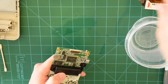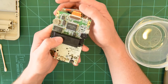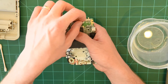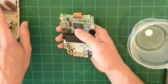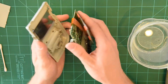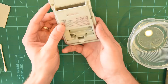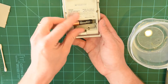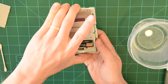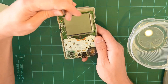I'm going to put the screen back in. Right here I have a screen that we disassembled from the last video, and all you've got to do to reassemble it is put this ribbon cable back in. Push both these little clamps back down and just like that the screen is reattached. Now you're going to need to use these battery terminals. Put the motherboard back into the back of the Game Boy Pocket — there's a little spot to put our batteries. We're going to see if this works. We'll put a little game in just for kicks and giggles. So right here we've got our power switch — we're just going to flick it on and see if it works.